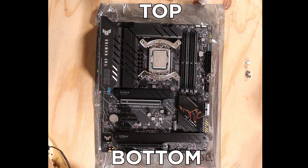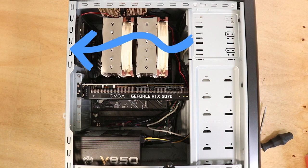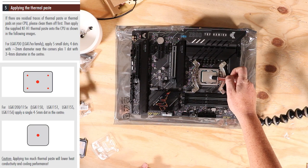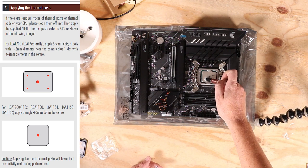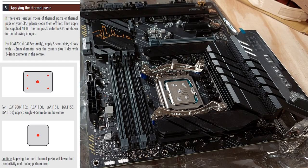In my PC I install the bracket horizontally so that the heatsink is vertical and the airflow passes horizontally in the case. If you have an exotic configuration and want the airflow to be vertical you'll need to mount the brackets vertically, which corresponds to orientation B. Next I apply the thermal paste. I'm using the one that came with the cooler and following Noctua's recommendation, which is a pea-sized dot in the center and four dots about 2mm in size in the corners.